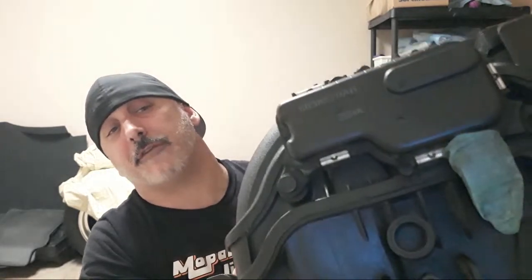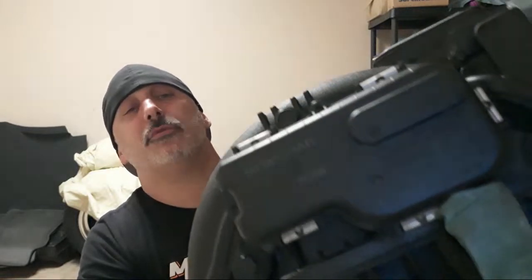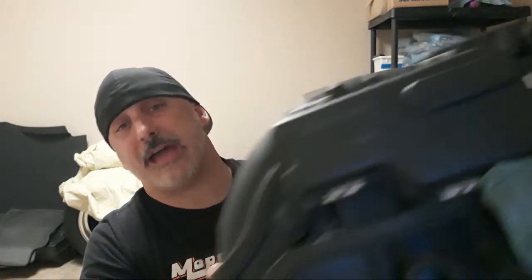If you're thinking about going with a ported manifold, I will say that it's best, if you have a 6.4 car, to send your intake manifold out. Let me show you what I'm talking about here. If you're going to send it out to get ported, send your manifold out. See that sensor-looking thing? It's a finger of my rubber glove on the bottom so I didn't get anything into the connector. That is your short runner valve actuator. And if you've got a 15 or a 16, I don't think we're into these problems with the 17s.